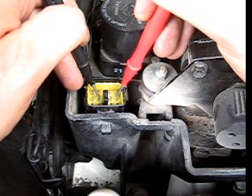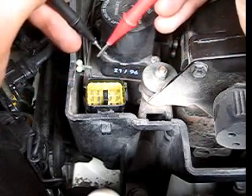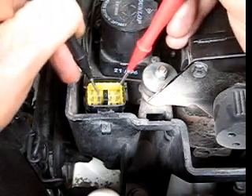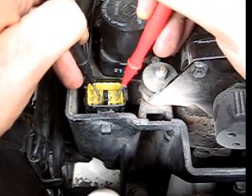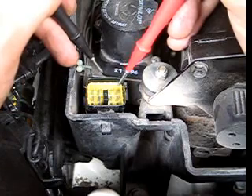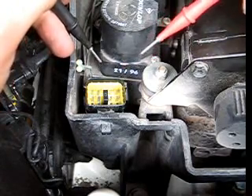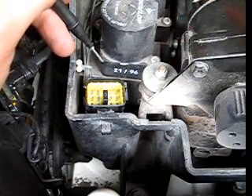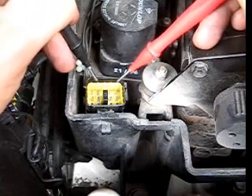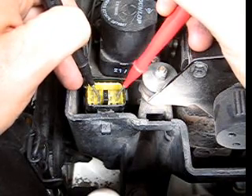That is a completely open connection. If I'm connected, I get a beep. Right now pins 7 and 9 are open, which signals that the pressure is below 120 psi. So what we're going to do now is manually run the compressor using the fuse box jumper method. I'm going to start the engine, manually run the compressor for about 5 to 10 minutes, and see if we can get the state of this pressure switch to change from open to closed.